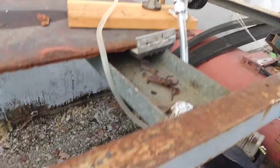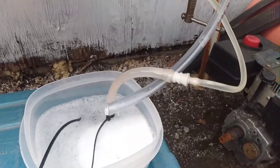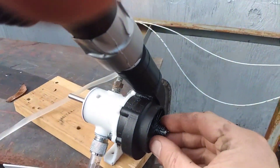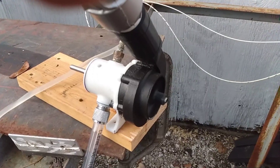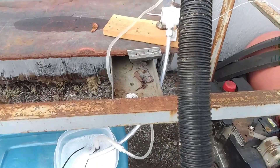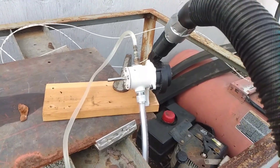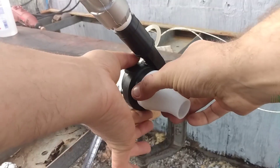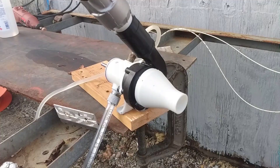This air leakage is standard for a turbocharger — they're really not sealed that well, and seals at this kind of speed tend to break down very quickly, which is why they're normally equipped with dynamic seals. It stalled again off-camera. It seems like the shaft is a little too tight somewhere, and my best guess is the hole right behind the impeller, since there won't be a lot of lubrication there. If it's really tight and rubbing, it will generate heat, pile up plastic debris, and eventually seize.